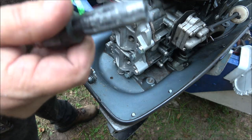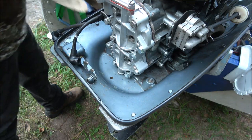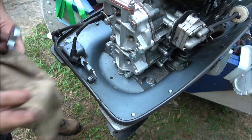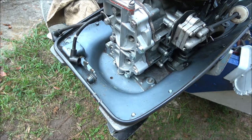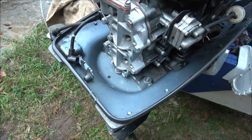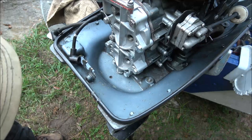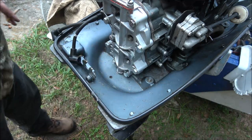See — it caught most of the cuttings. I'm going to wipe this off nice and clean. Looks pretty good in there. What you can do is pull that rope a couple times — or if it's got electric start, crank it over a couple times and it'll blow some of that out. Yeah, I can see it blew a little bit out — I'm not sure if the camera picked it up.